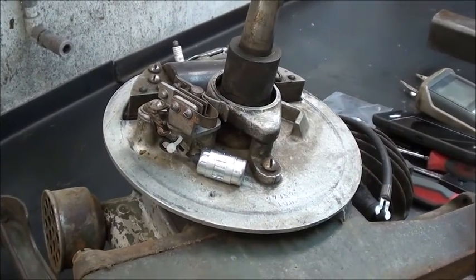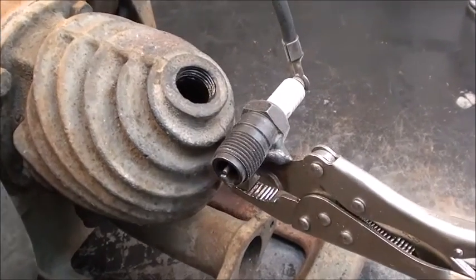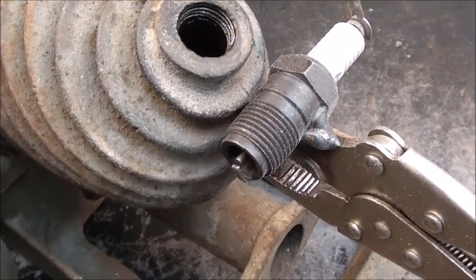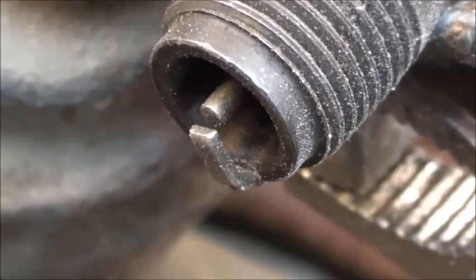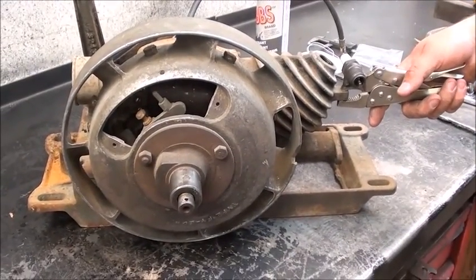Now we can install the flywheel and see if we have spark. A good sparking engine should spark just from rolling the flywheel by hand — roll it quickly and you should get plenty of blue spark. Any other color of spark is a sign of a weak coil or something improperly adjusted. And there you have it. With the spark all properly adjusted, all that's left is to tackle the fuel system and the engine should be running. If you want to learn more about Maytags, you're welcome to call us for technical support. We also have a five-disc DVD series on how to rebuild a model 92 engine — a lot of it applies to the model 72 and 82 as well — available on our website or by calling 5Wheel Supply at 712-562-6011. Thanks for watching.